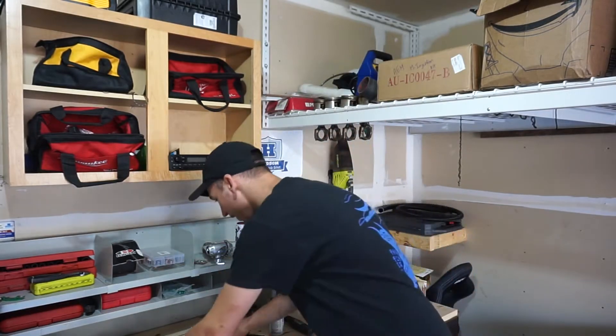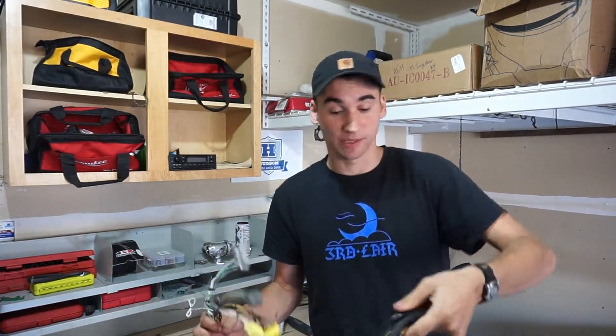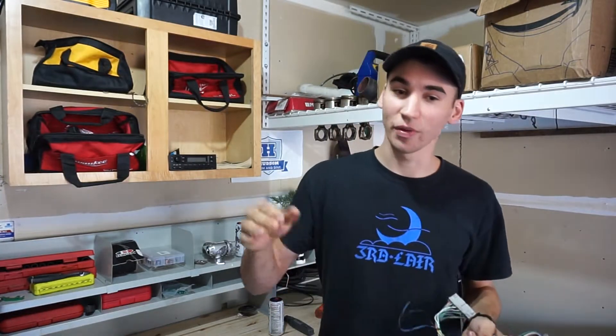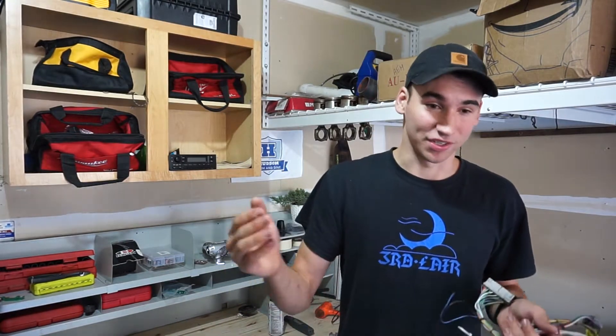Now this isn't just any harness. This is a custom B/D series tucked OBD1 harness, and this one has been made specifically custom for my 97 Civic, which is an OBD2A vehicle. Depending on the year your vehicle was made, it'll be either OBD2A, OBD2B, or just OBD1.